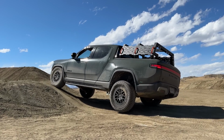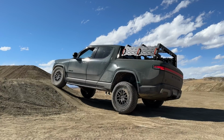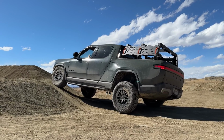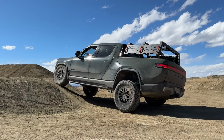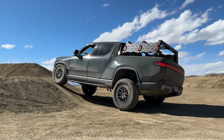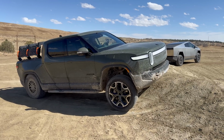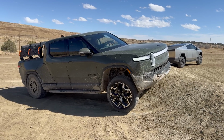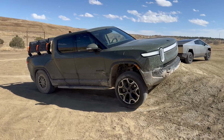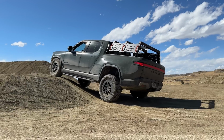Okay, so here we are. We have the weight off the back left and the front right. What I'm gonna do now in just this base profile is apply throttle, and you're gonna notice that those 2 wheels will spin, but the 2 wheels with traction, it's not using brakes to transfer power because there's no differentials here in the center of either axle. It's actually going to be just giving the wheels with traction a little bit more power. Watch here. So even though we're spinning, or we might not even be spinning, here we go. And we're crawling up just fine.